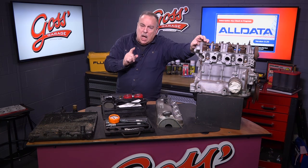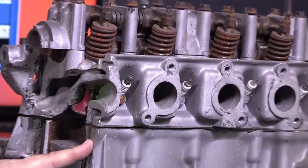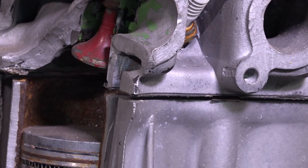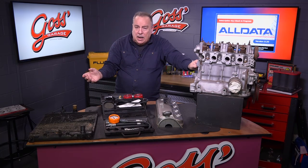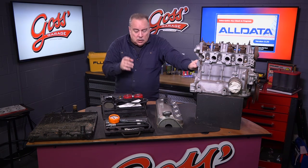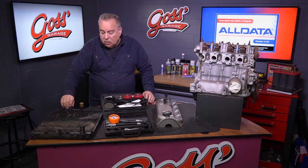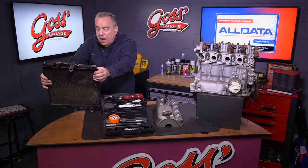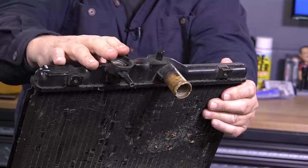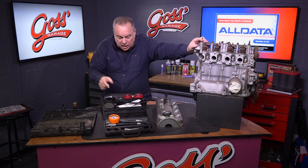There's another step because there's a really common problem on lots of late model cars: the gasket that fits between the cylinder head and the block — the cylinder head gasket. They fail in many cases, and everybody seems to think that if a head gasket fails, you're going to get water in the oil or smoke out the tailpipe. That isn't always the case — maybe in extreme cases, but not all the time. So one of the things we can do is take the radiator cap off and listen at the radiator, and look down in it. If we see bubbles or hear air coming out there, that means we have a leak in the cylinder head gasket. We've got to pull the top of the engine off, put a new gasket in, and check things out.